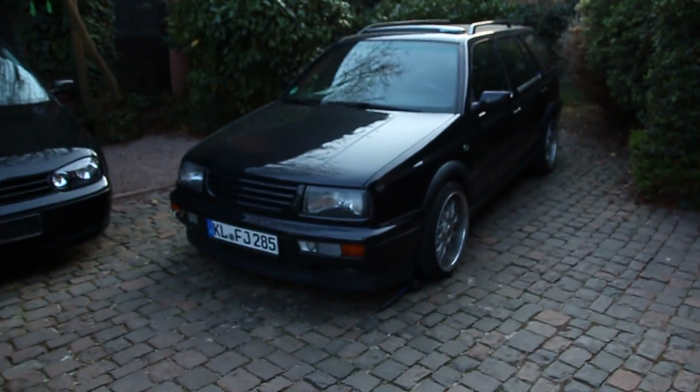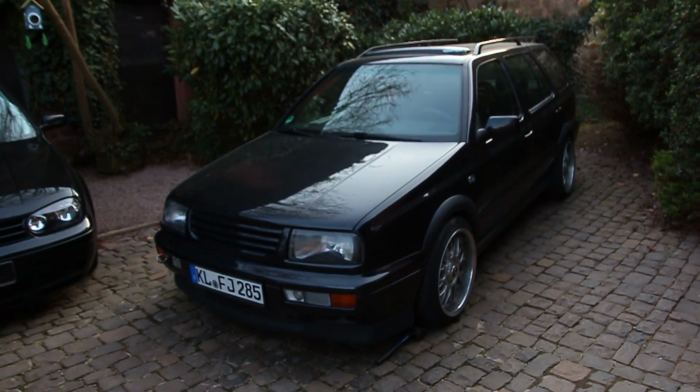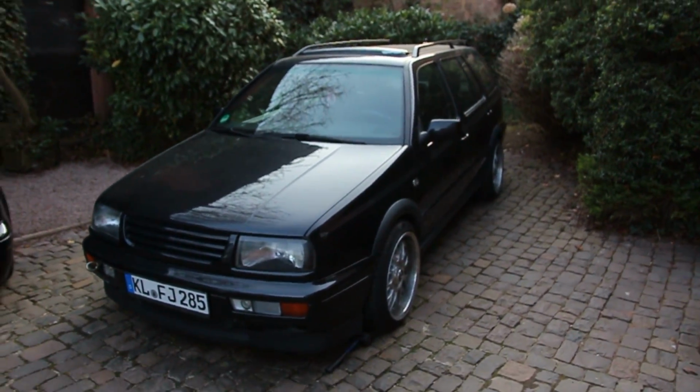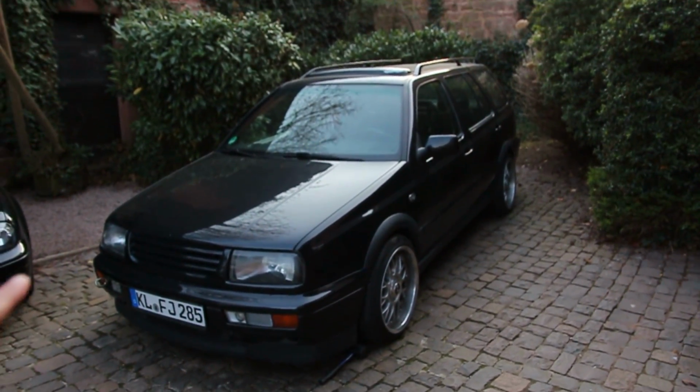At first, I thought it was the e-brake in the back that was locked up, but it's actually not that. If you guys remember, the engine on this car is actually seized up right now. One of the rod bearing caps or something in the bottom end broke. We had all those metal shavings in the oil pan, which are sitting in the passenger seat right now. I thought it was the e-brake that we couldn't move the car, but it's actually because the engine itself is locked up, which is why the car cannot roll.